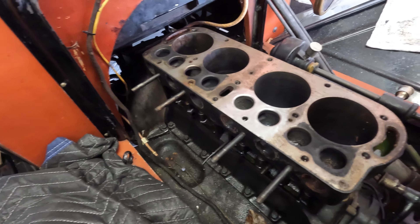Yes, I could mark them so I know which ones they are, but I'm not in a rush here, so we're just going to do this one at a time. I've already got the ultrasonic cleaner heating up - 38 is the target temperature, 25 is where it is right now, and that is Celsius. I'll put the piston in and the wrist pin and the bolt and we'll let that cook for 50 minutes.